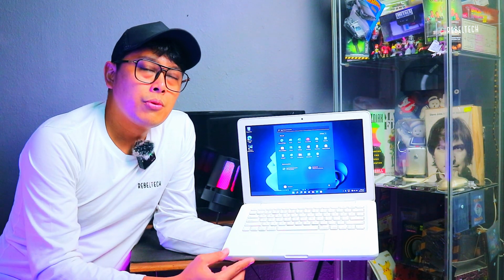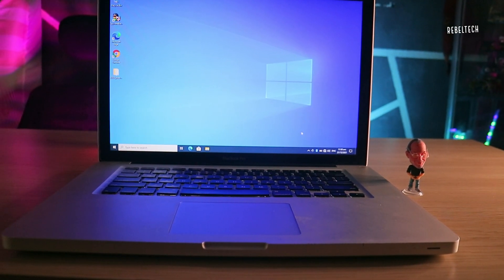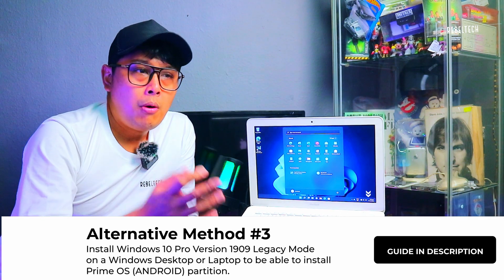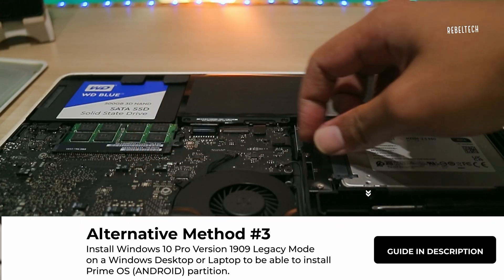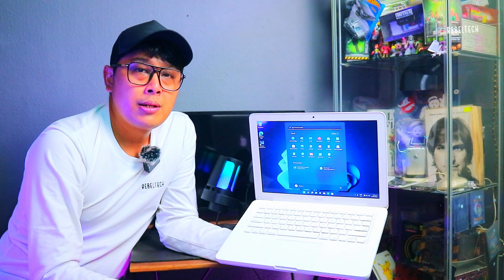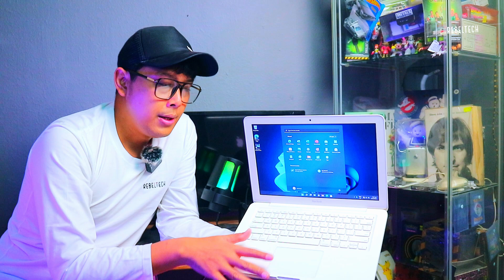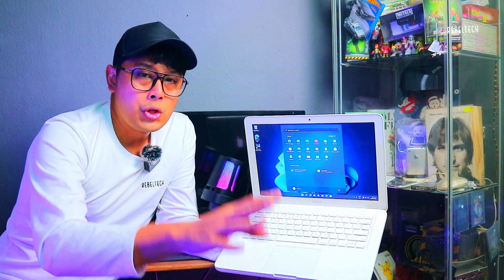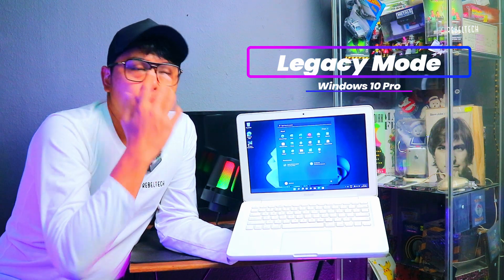There are a lot of techniques and methods, and I'll be sharing different ones — links will be in the description box below. If you don't like Windows 11 and prefer Windows 10, same thing: install Windows 10 on a Windows laptop in UEFI or legacy mode — I prefer legacy — then put that drive inside this model as a secondary drive. You replace the DVD drive with an SSD. You can then have macOS Monterey on one drive and Windows 10 on the other using the same method.